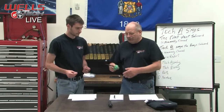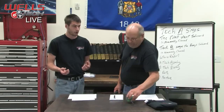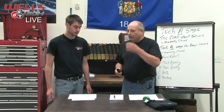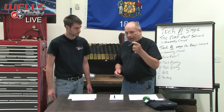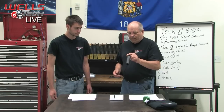And if you don't have a filler cap like this, what's your next option? Then you're probably going to have to pull the filler pipe or filler neck off of the fuel tank and introduce smoke into it from the bottom, from a cone, a little duck call gadget like this. You just stick this up there, but it's a lot more work. You'll see in that video that's what we ended up doing. But it does work. So there you go.